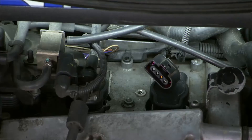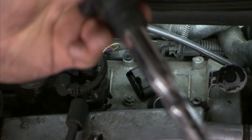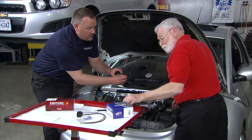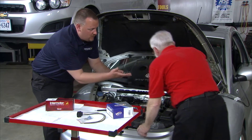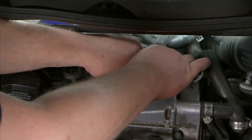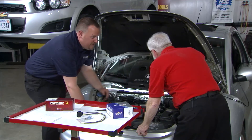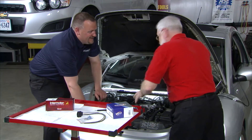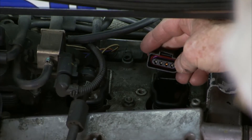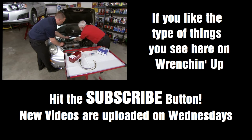Let's go ahead and get this thing replaced. First thing you'll notice, there are no bolts holding this coil down, so it comes up relatively straightforward and simple. We're going to take our new coil — it's already got a little bit of dielectric grease in there, so we don't have to worry about further insulation. Gently install it in place, do a little bit of twisting to make sure it's seated fully. Things like prying, hammering, and banging — don't do those things, as that kills the warranty. Now let's get this connector replaced and get this vehicle down the road.